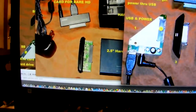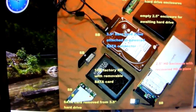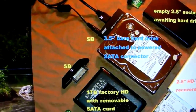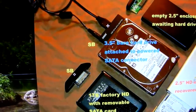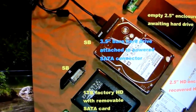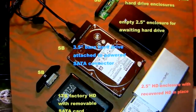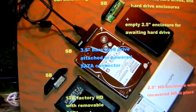This is what you need. Remember — if you think your external hard drive is dead, it probably is not. Here's a three-and-a-half inch connected to the Anker direct connector, with power here and USB here. So if your external three-and-a-half inch hard drive fails, this is how you fix it. Your hard drive is fine — it's just the SATA bridge card. Here's an external enclosure, and if you go on eBay, Amazon, or Best Buy, 85 to 90 percent of all empty external hard drive enclosures are crap.